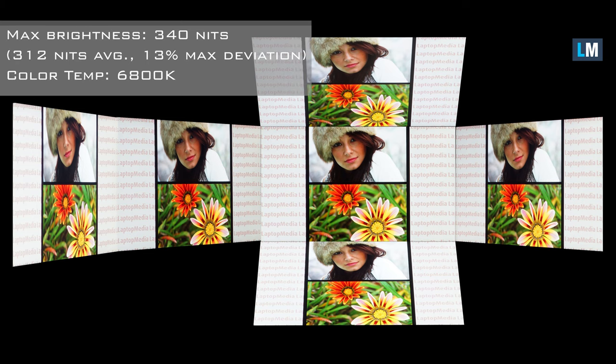Viewing angles are excellent. We offer images at 45 degrees to evaluate image quality. We measured a maximum brightness of 340 nits in the middle of the screen and 312 nits as an average for the whole area, with a maximum deviation of 13%.